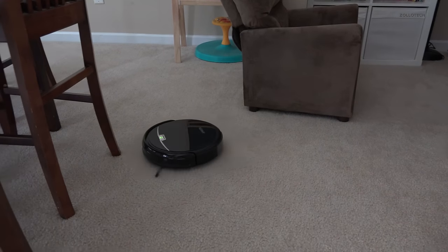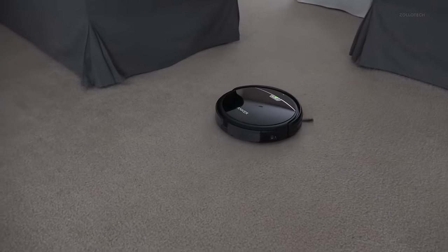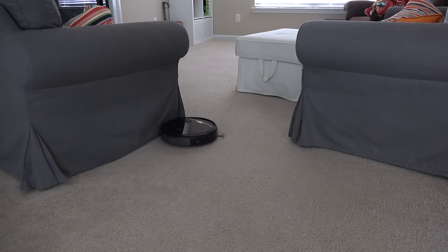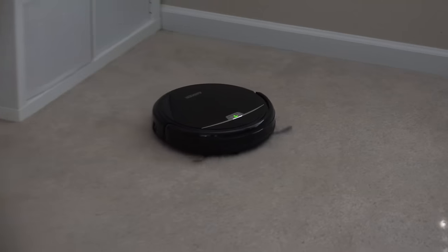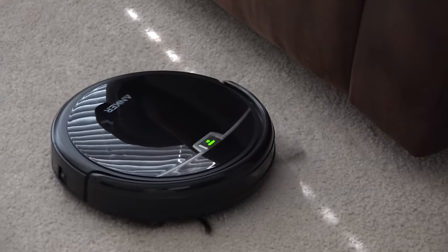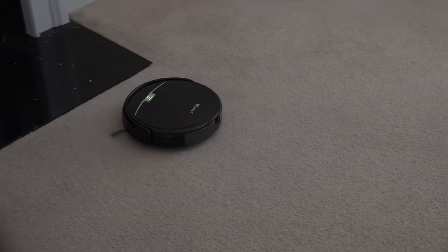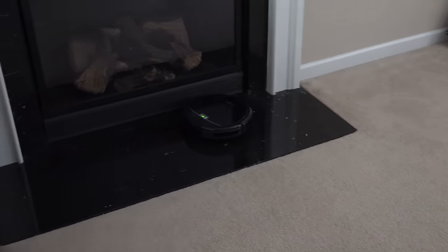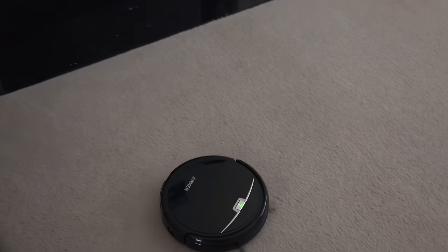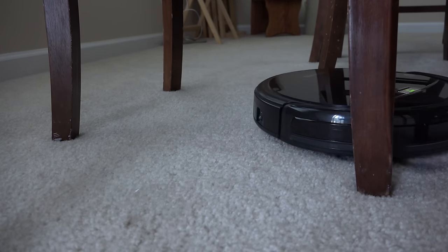It really does a good job and surprisingly picks up a lot of dirt, as I showed you before. It will go underneath couches if they're open. If you have couches with little flaps or pieces that stick down, you're not going to have it go under necessarily as much because sometimes the proximity sensor will pick that up so it doesn't hit it. But it will generally go under couches and anything shorter than it. If it finds an object, it simply either bumps into it with the front bump sensor using a push mechanism, or it just senses it and turns the other way and keeps going. It works really well, especially in complicated areas. The one area it doesn't work well is if you have a tight area or a bunch of little cords — sometimes it can actually suck those up. So you want to make sure any cords are picked up. It will just stop itself after it can't escape for a while and stay there until you come to rescue it.